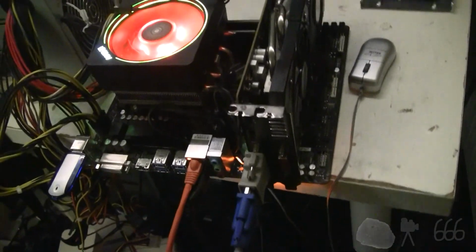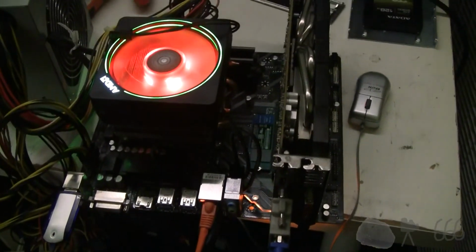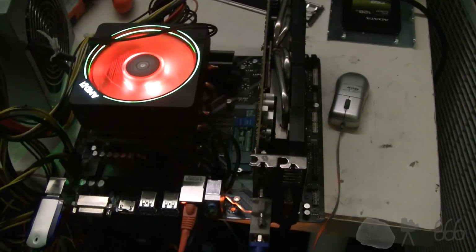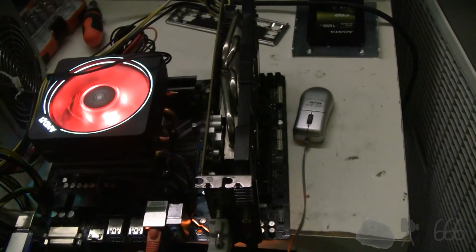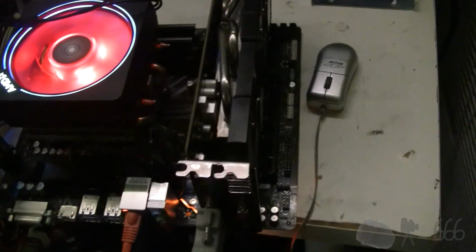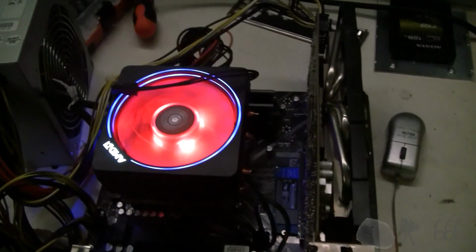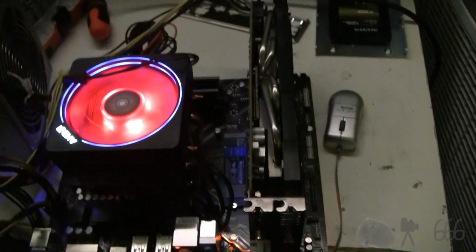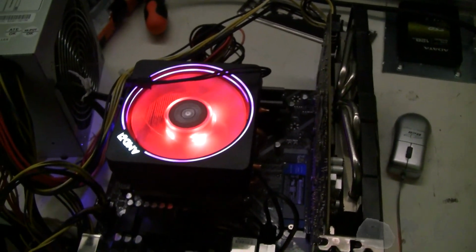But there is one more problem that I failed to realize is going to be a problem. I need 3 network interfaces, 1 wireless and 2 Ethernet. I can put the wireless in here now. I cannot put a second Ethernet in because this thing does not have any PCI slots. So, oops, I'm going to have to add that later. But that's not a big deal. Most of the core functionality I can do now. The rest of it I can do later. I don't really care right now. Good enough for the time being.